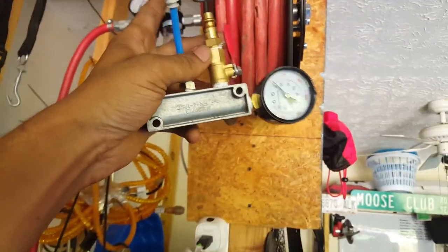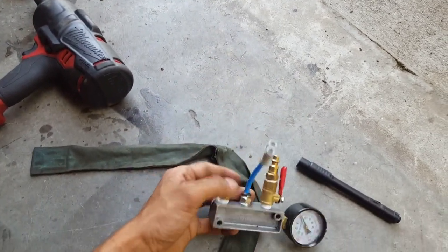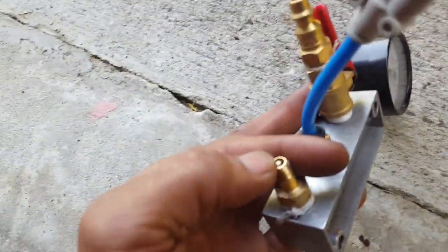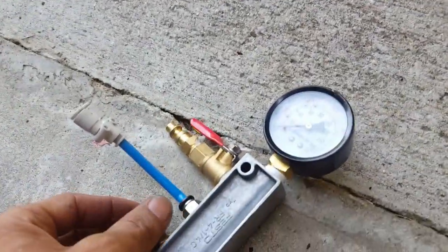What that allowed me to do was run my external air compressor — connect here, open this valve, raise the truck up, and set the height to what I knew it was supposed to be, which is 23 to 24 centimeters. I did that while working on getting my cylinder valves hooked up. This also means if I came back and saw my lines were way low, I could go to any gas station and put air in there. So that was just my temporary fix.